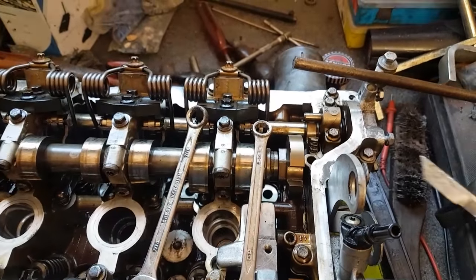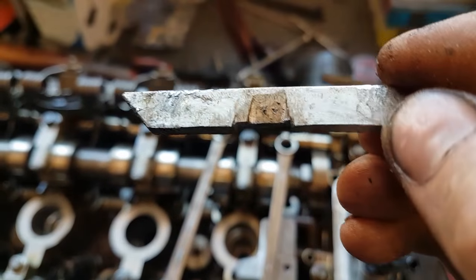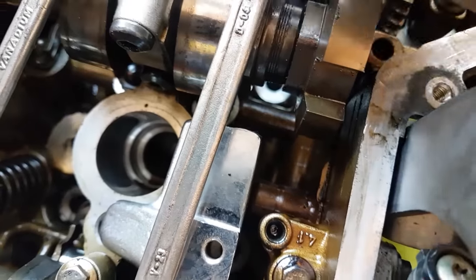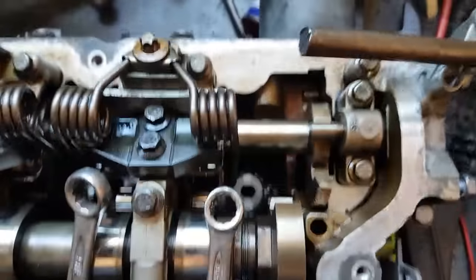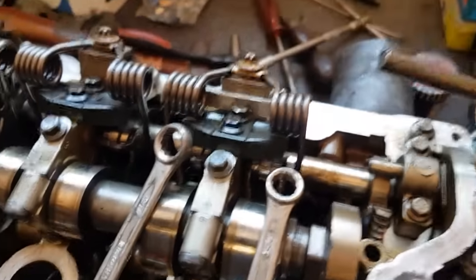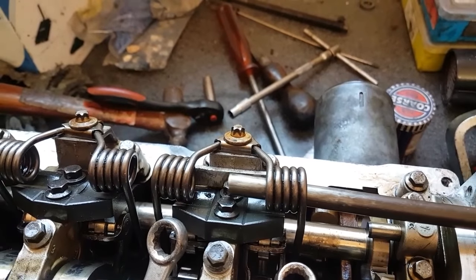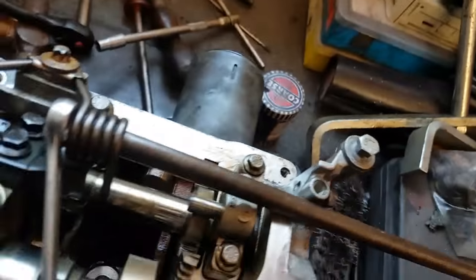This is how I've devised to get the springs back in tension where they should be. I've got a piece of aluminium, just a bit of scrap I had knocking about, and I've filed a piece out of the center so that this piece can go behind the spring — the filing is so that it goes past the bolts. The reason for that is we don't want the spring to move forward, because when it moves forward so does the hole and you get a mismatch and won't get the bolt in. Anything will do — I only used aluminium because I had it and it's easy to work with. The next part is just a standard bit of rod with no thread on it, just rod, and a couple of spanners using the ring side.